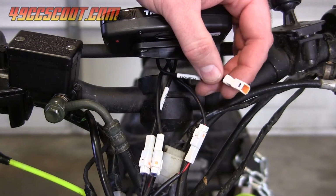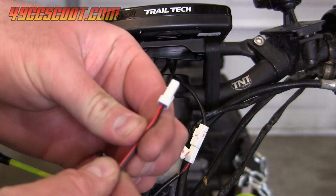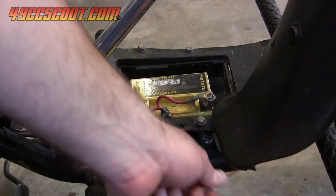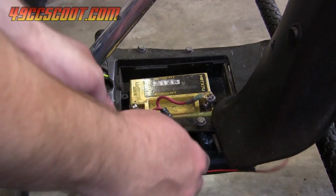At this point, all of my sensors were working, so all the Vapor needed was a power source to be fully functional. I connected mine to battery power, which is the recommended way, but the Vapor can even be connected to the stator when no 12-volt system is available. I started by connecting the power leads to the connection from the Vapor marked as power. Then I ran the wires to the battery.